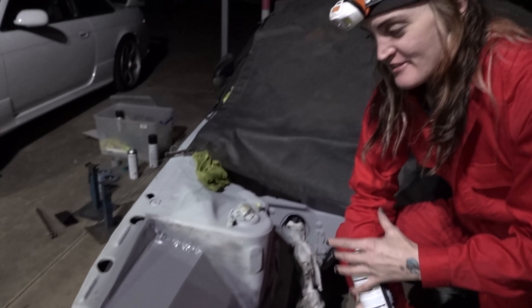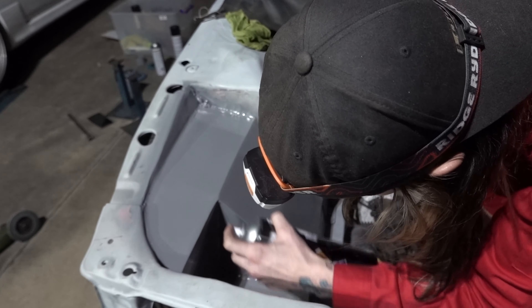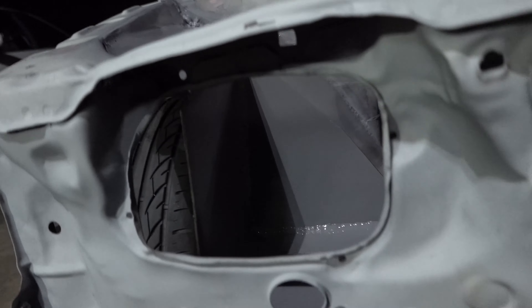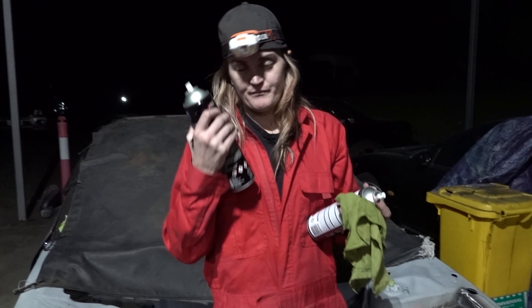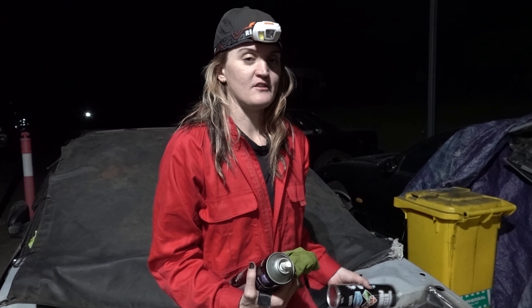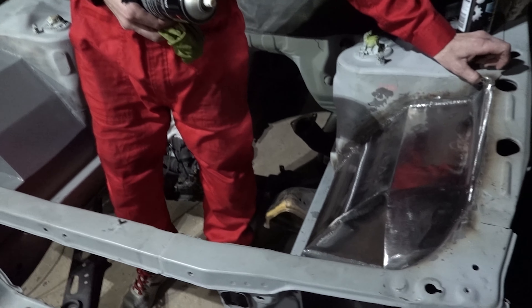Now that I've covered it and sealed it I can see the imperfections a lot easier. For the guys that don't know — just clean everything with brake parts cleaner. It leaves no residue, so once you've wiped down something it's good to paint over. Then the etch primer seals off the metal until I can come back, sand it off again, and continue working on it.